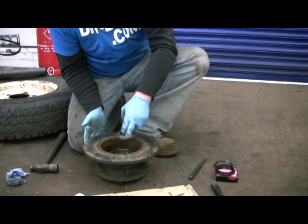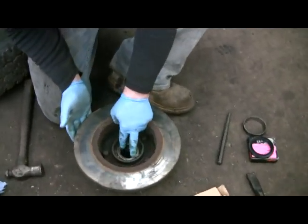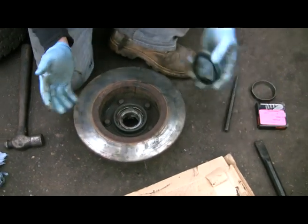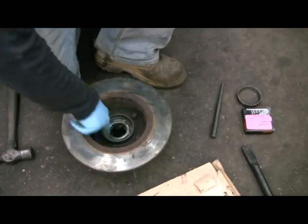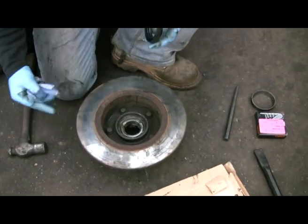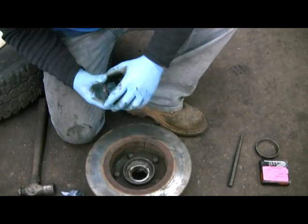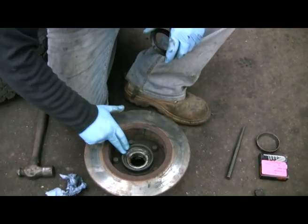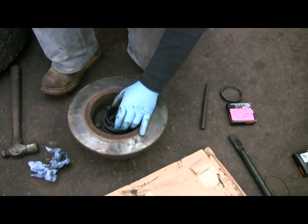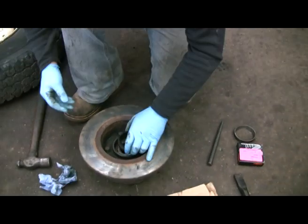Let me have a look down here. That goes in the hole like that. Put it in, lovely. New seal. Just run some fingers around there. Don't necessarily need to. I should mention that cleanliness is of the utmost when you're doing this. Don't try and do it in the sand on the beach or the desert. There's the new seal. This bit faces outwards.